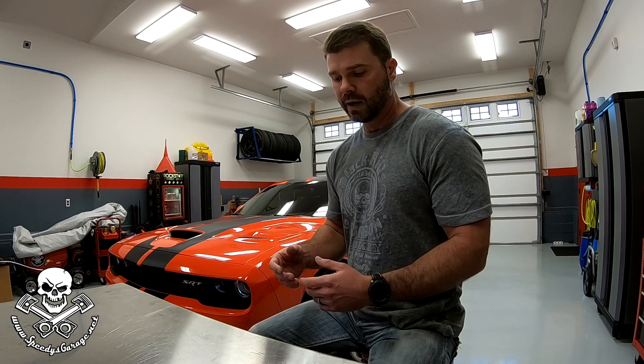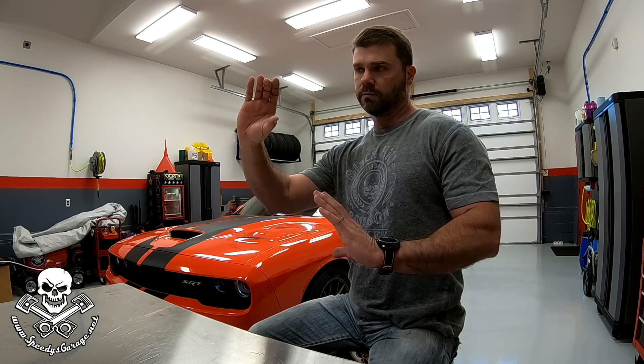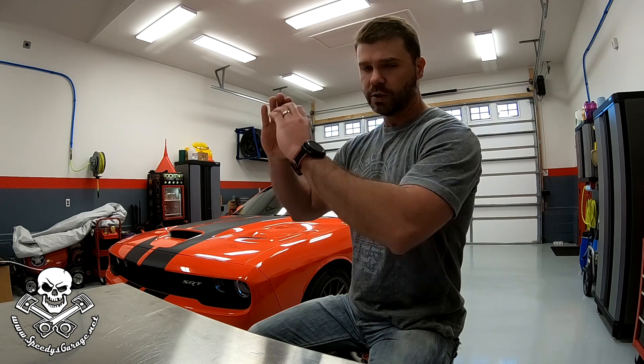So there you go from what I consider to be an expert for the Dodge platform. Let's recap what he told us. Number one, tuning on 93 octane with the 2.72 Hellraiser pulley is no problem — he's done several of those and was involved in some of the early tuning for that pulley with the company that produced it. He's also had a bunch of customers running the 10% ATI lower with the fixed 2.85 upper pulley — that combination makes a little more boost than the 2.72 alone. When you do a bigger lower pulley and an upper pulley, you're spinning the supercharger faster and making more boost. So let's say the 2.72 makes 16 pounds, the ATI lower and the 285 upper probably makes around 17 pounds. And he's tuned a bunch of those on 93 as well — not a problem.